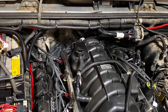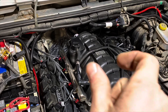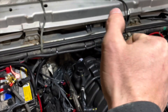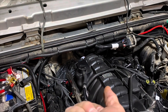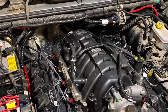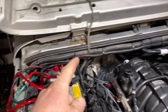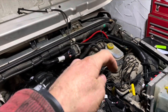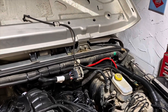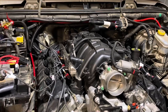Don't forget about your transmission plug — I've already got mine in. You just basically push it in, grab that tab, and that tab has to rotate all the way down to the very bottom until it locks. That thing has to be fully seated. So we got the big red wire there, got that through the back, and that's hooked up down to the starter. Don't forget about your grounds. Grounds are a huge, huge problem with these things.